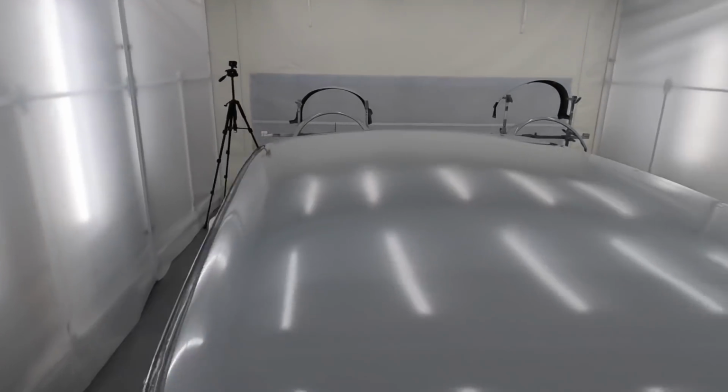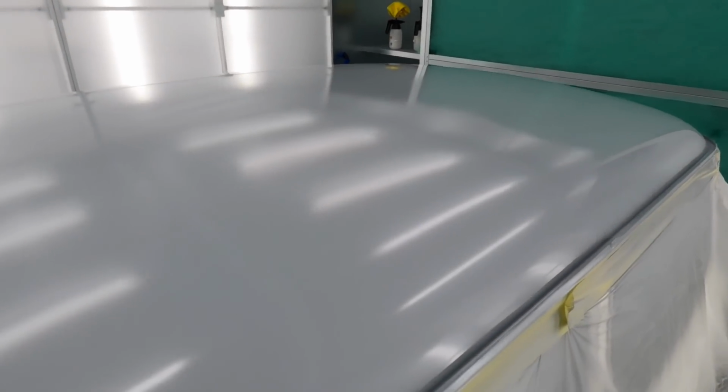When we was sanding it, there was some silicon patches and some bits and bobs. I can't just try and show you in the light, I can't really show you. I've got something dodgy going on in this area that I'm not happy with. So I'm going to put some high build on this and block it down in the morning. But yeah, we're getting there.